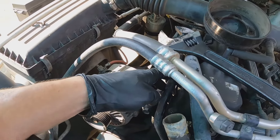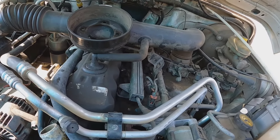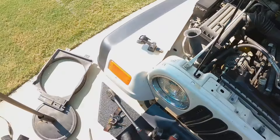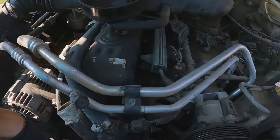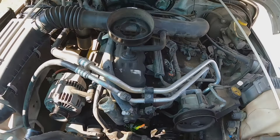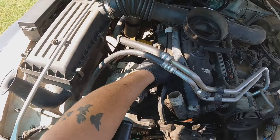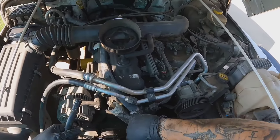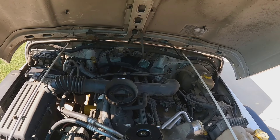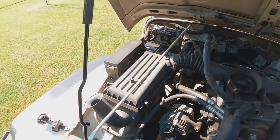Since this is a hard line, it's going to come out with it, and then I'll loosen it up. This hose is extremely hot, so I know this coolant — if it touches my skin it will burn, so you've got to be careful. Even these bolts are hot. At this point we can go ahead and pour it off — make sure our drain pan is under there. I did take this hose clamp off so we can just slide it out. Looking at all this stuff, these hoses are probably going to have to be replaced before too long.